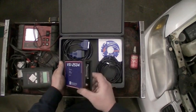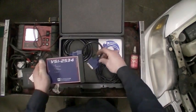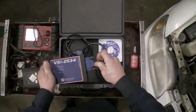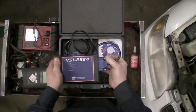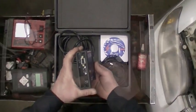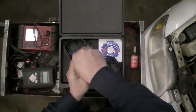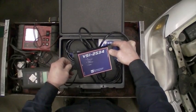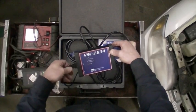While your computer is installing the software, connect the vehicle and USB cables to the VSI. Be sure to tighten the thumbscrews, as this will help prevent damage to the unit from accidental drops or cable pulls while communicating with the vehicle. The aluminum housing and the patented thumbscrews on the USB connector provide rugged reliability and differentiate the VSI from other competitive product designs.